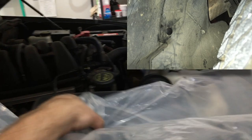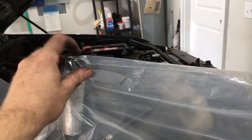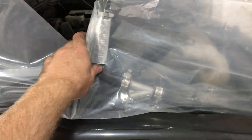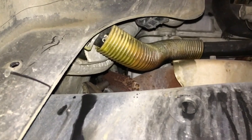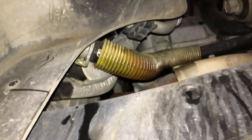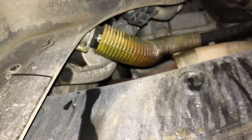This section right here is going to be going into the heater core valve. I'm just gonna go ahead and take out the whole heater core valve with it — it was way too hard to get the bottom thing disconnected, so I'm just gonna do it when it's out of the car. Disconnect the bottom, pull the hose out, and we'll be ready to put the new one in. When you're under the car, you can see it right there — it's covered in coolant, so that's where my leak is. This position makes it pretty much impossible to pull that clip off with pliers while also holding the camera, so I'm gonna set the camera down and I'll be back once I've pulled out the hose.